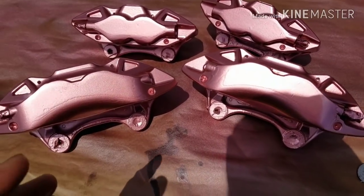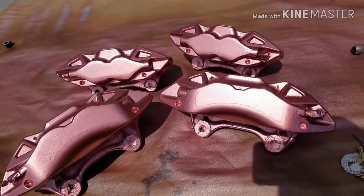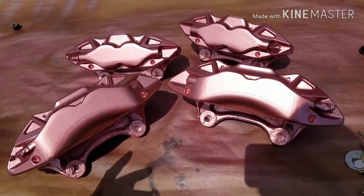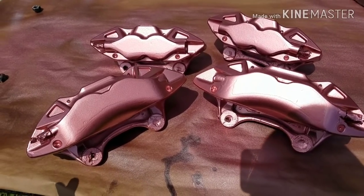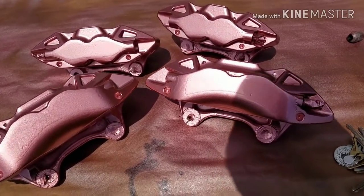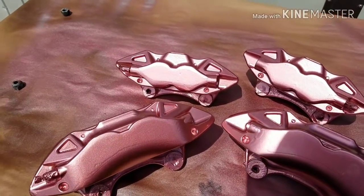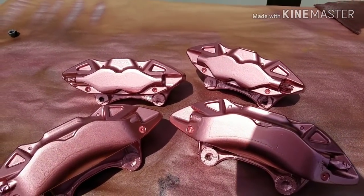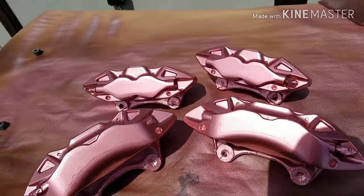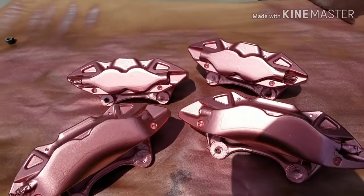But my car will be a highway car, man. This ain't no trailer queen. It may be on the trailer, but it's not getting built to be on the trailer. So I'll probably do it on the front cap, hood, bumper, fenders, etc. You get 7 days to cut and buff this. After that, I heard a lot of horror stories. They say it was hard as crap and didn't want to buff. I seen one guy in the Tamco group said he buffed it months later. He had no problems. So maybe he had a different method, but I heard a lot of horror stories. After 7 days, you can't buff. If you do buff, you're going to catch hell.